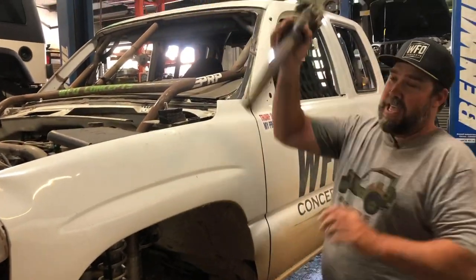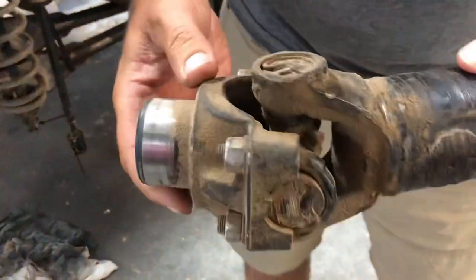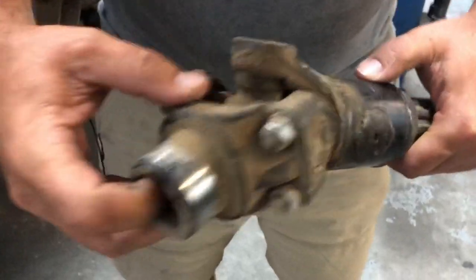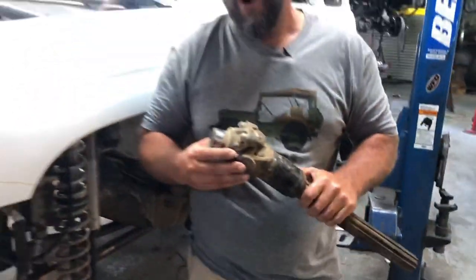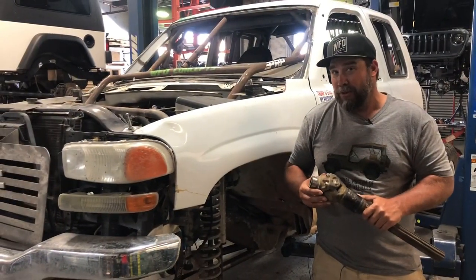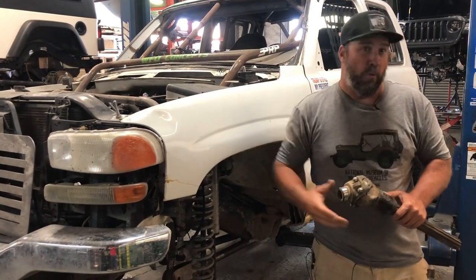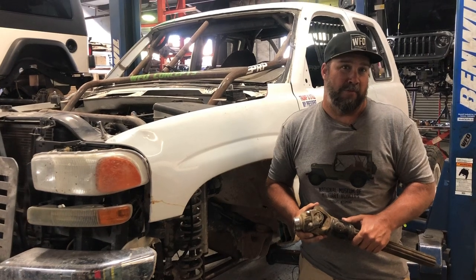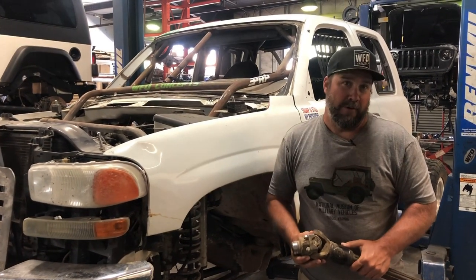It's not looking good for me. Here's the front driveshaft and yoke. If you look down in there — no pinion broken off, no nut in here tight. So what this is showing us is that the pinion nut simply rattled loose. And as soon as the yoke popped off, that pinion went north. We're going to take the cover off and see if there's any more evidence to prove this and throw it all back on me.